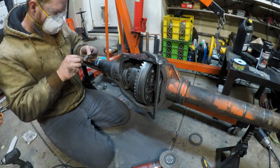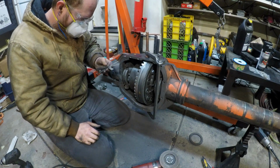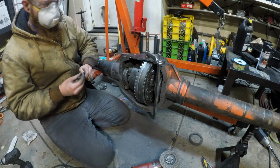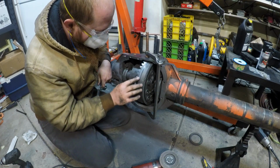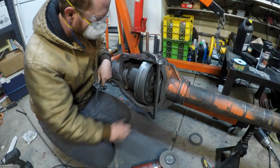Okay, where are we at? 20, 40, 64. So we're at 64 thousandths. We gotta go to 71. So, close. And we got the taper to taper the opposite direction, which means that if we focus right in the middle on these last little bits, that'll be probably the perfect thing we could do.